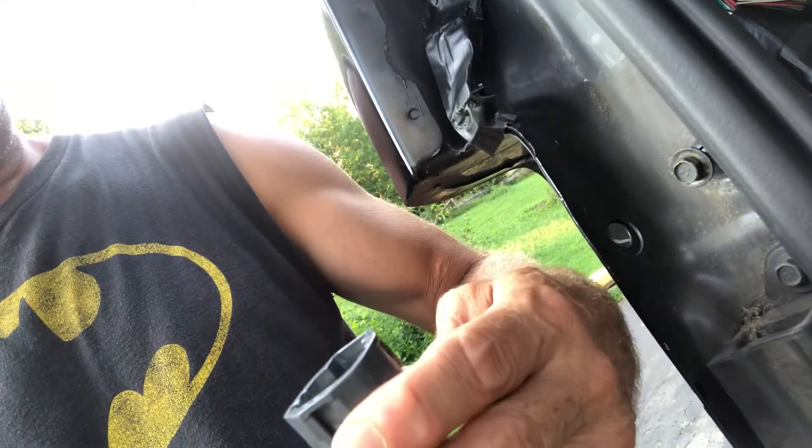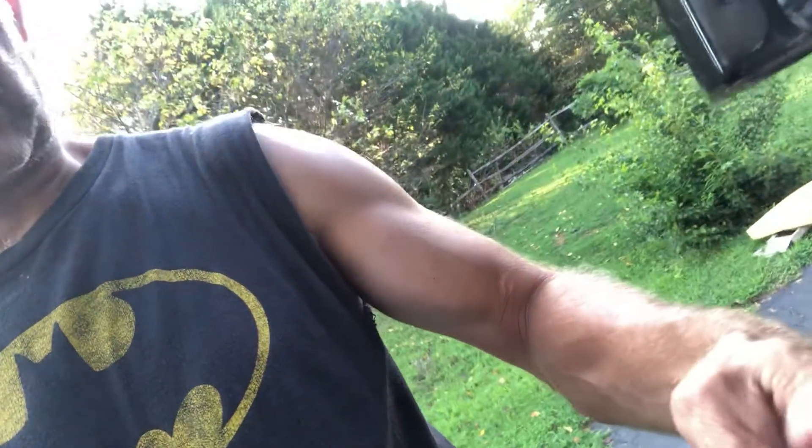This happened again, so I thought I had the same problem. I went to AutoZone and got a new brake switch, put it in — no luck, the brake lights still stayed on. I tested the connectors for the brake light switch and for the rear lights; they all passed, but they were getting constant 12 volts even when the car was off. Everyone online mentioned the brake switch first, but since I bought a couple of them and that didn't fix it, I had to investigate further.